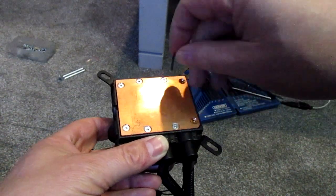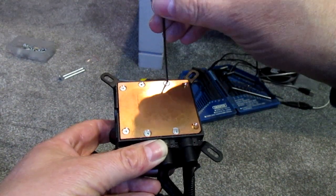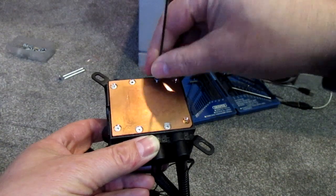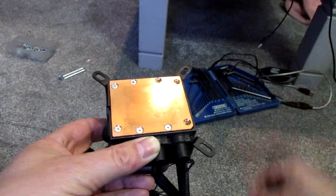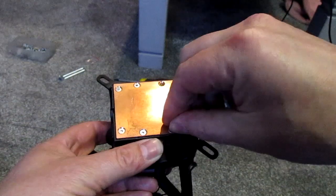When you do the shake test on it you can tell it hasn't got hardly any water in it — you can hear it sloshing about. An all-in-one cooler when you shake it shouldn't have any movement at all really. A small amount of air probably ain't gonna do a lot of harm — that'll just sit at the top of the rad — but over time if it starts getting too much air in it, that'll destroy the pump, which is what usually kills most of them.